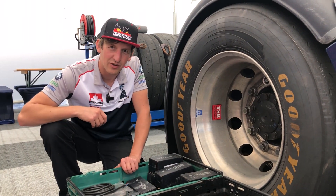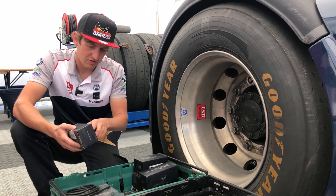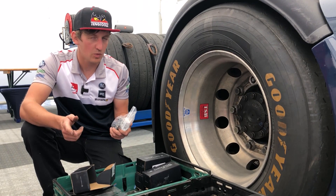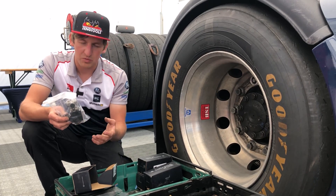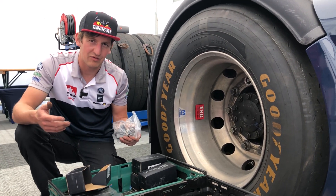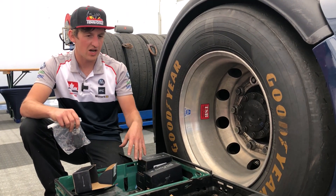We also carry a gear knob and gear lever, just in case — they're not designed for an angry man shouting and pulling the gear hard, so sometimes they don't have the easiest of lives. Then we have solenoid valves — these are PE parts designed for air, but we actually put water through them to control the brake water and intercooler water spray. They're not designed for water so we expect them to fail, but we haven't had one fail yet. We do change them at the start of each year because the water sits in them for three months, and for the price of them it's extra peace of mind.